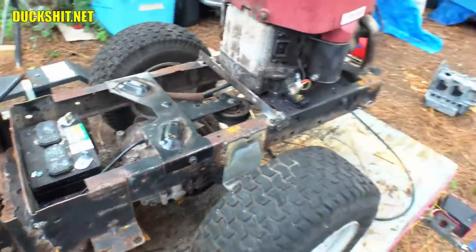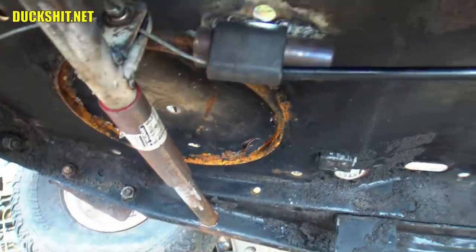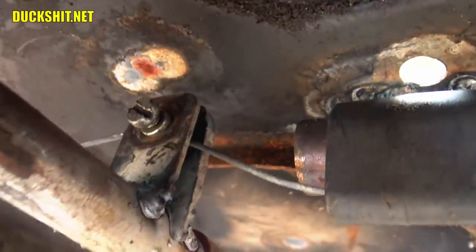The manual clutch is mostly all original mower parts just disassembled and reinstalled in a different order. I added an extra spring to return the pulley back to position, and there really isn't much force required to move this, so I only used a beetle throttle cable with a Z-hook on the clutch end, with a bicycle outer wire cut to length and a mower handlebar mount for the cable up front. The pedals are stock mower pedals inserted directly through the frame and allowed to turn in the central coupler. I'll probably weld this coupler in later, but at this point it seems to be working well. The end of the cable is secured by a VW throttle cable holdfast — the same bit you'd use on your heater cables or the throttle cable back on your carburetor. Real simple stuff.